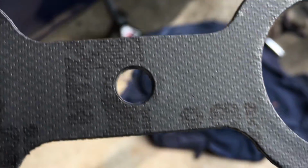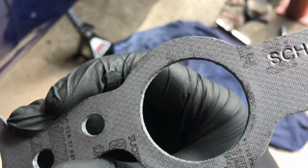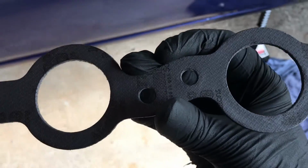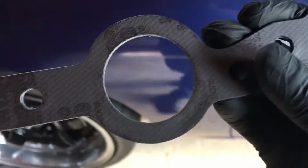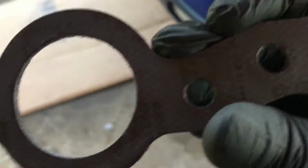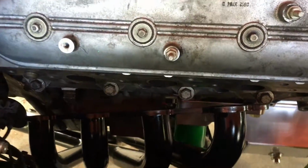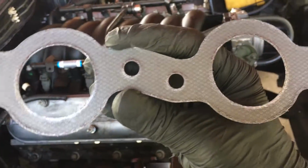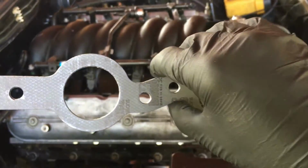and there is no exhaust manifold out or this way forward or anything like this, but there is this lettering, and of course you have in the center it angles up, and if you look on the actual head, you can see if I can get a good angle of it, you could see the bolts right there angle up, and obviously, angled up goes there. If you try to put it on that way, it'd be angled down. That doesn't work.